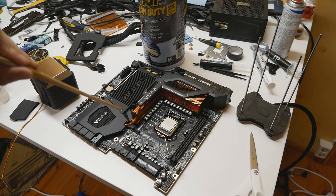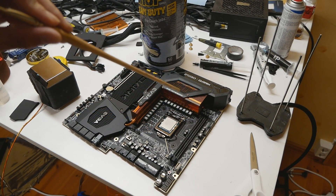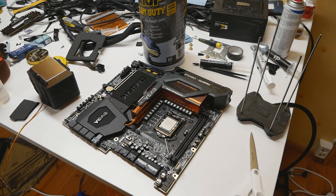We insulate with Vaseline, acrylic eraser, PlastiDip, or similar — we don't have to remove the whole heatsink assembly or go through the MOSFET areas. Those will stay at relatively cool temperatures even on LN2. When I run CPUs on LN2, VRM temperatures usually go to around plus 15°C, and at that level there's no condensation issue.